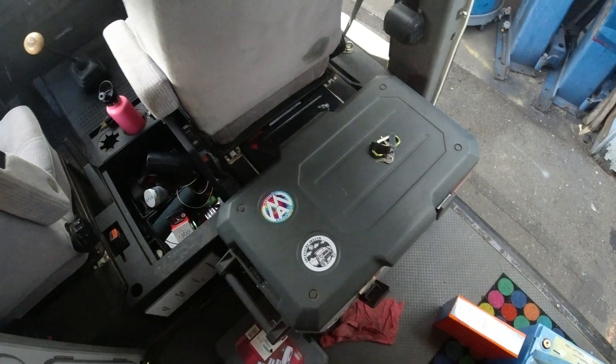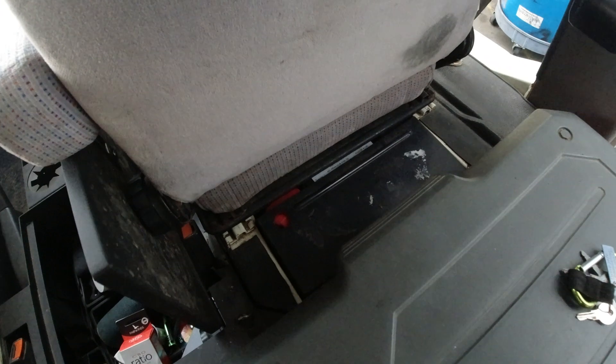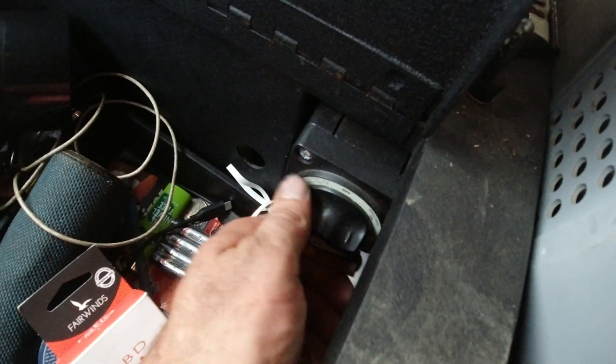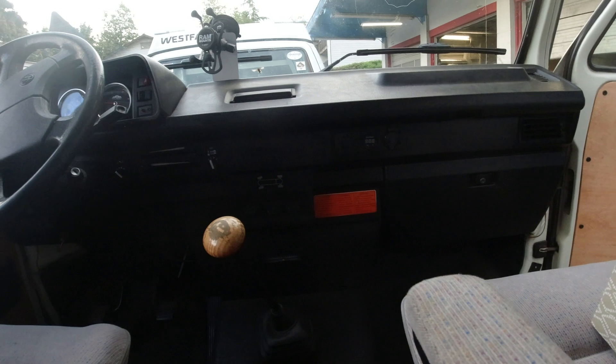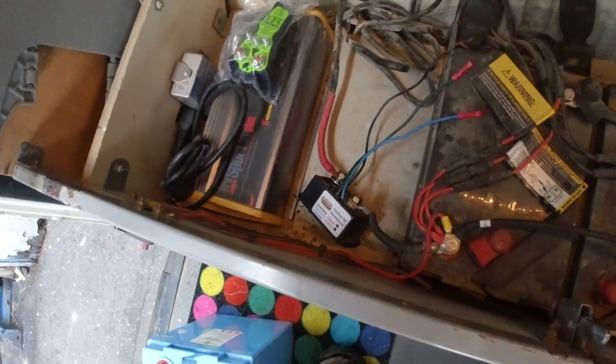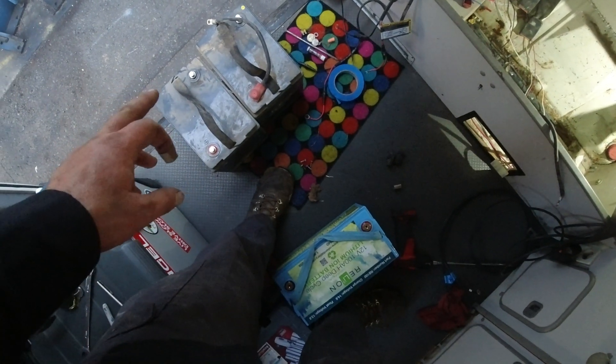Since I have the combiner wired in, my house battery has power right at this wire right now, so I want to kill the power. I was going to disconnect the battery, but then I remembered I actually have a kill switch for safety - it also makes the van harder to steal. Watch my voltmeter: turns on, turns off. Now this wire is dead, now we're safe.